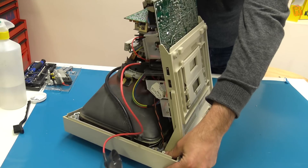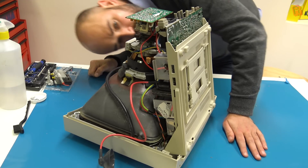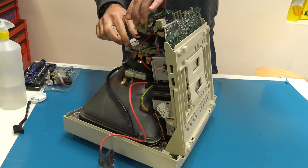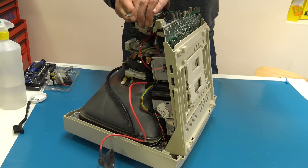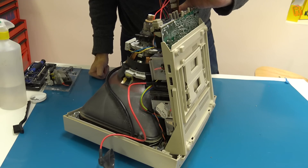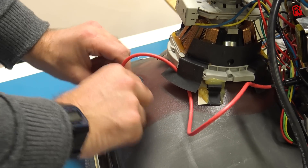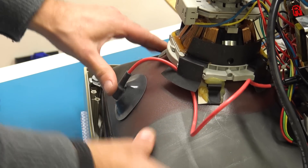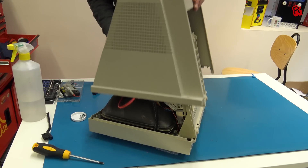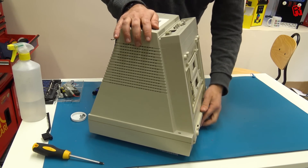But has it all been worth it? There's only one way to find out. Let's get it all back together, safely inside its plastic casing, and we'll power it on to see if we get a picture or a small nuclear explosion in the cave. Be sure to plug everything back in where it should be, especially the black CRT ground cable. If you don't do that, you're going to build up a big static charge that will want to find its way out — potentially with a snap through the screen and into your hand. So double-check those black ground wires from the CRT, make sure they're connected.